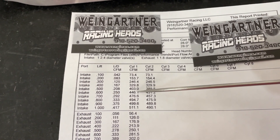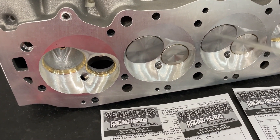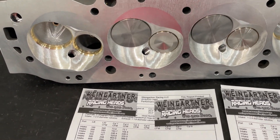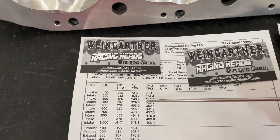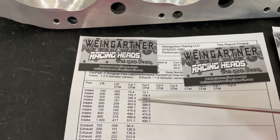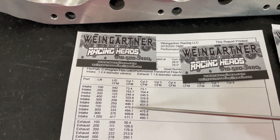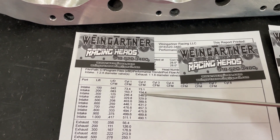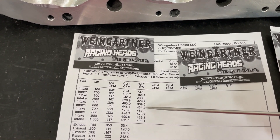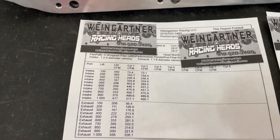The numbers I care most about are 0.400, 0.600, and 1 inch lift. The 1-inch lift — I know, most people don't run that, but there are several people running 1-inch valve lift with these heads. However, this engine is not; it's a street-driven 582 specced at 0.780 lift. Long runner: 330 at 0.400 — that's a strong number, most big block heads don't do that. 403 at 0.500, also strong. 446 at 0.600. 476 at 0.700. Peaking at 511. The short runner: 330 at 0.400, 390 at 0.500, 431 at 0.600, 457 at 0.700. The exhaust peaks at 326, with 213 at 0.400. This thing is a really good one.